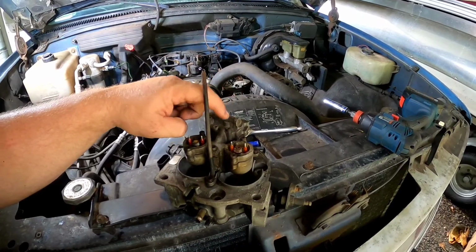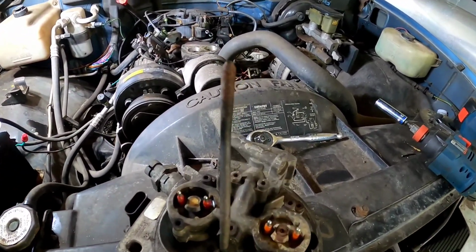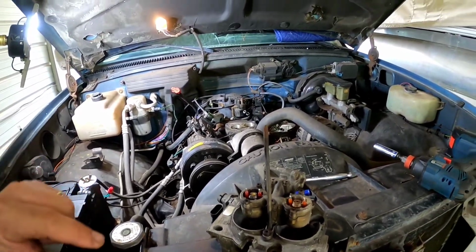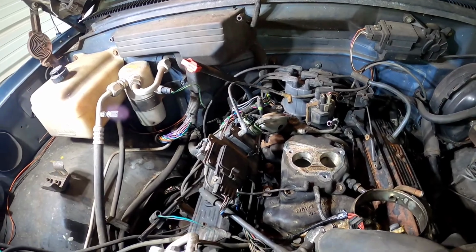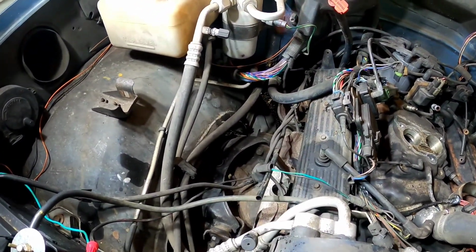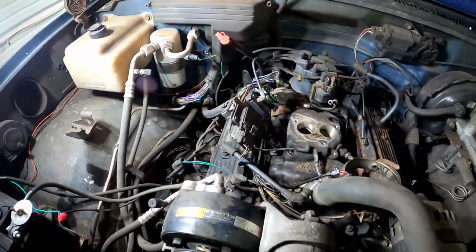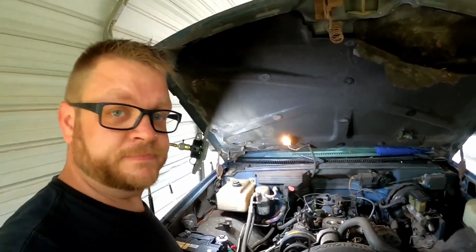We're going to get a new diaphragm kit that goes in here and have fun with all these little Torx bit screws that GM used on there. But I think we'll really be headed in the right direction once we do that. Intake manifold looks pretty good. I don't see anything crazy going on. Typical wiring looms come off of the wires, but all the wires aren't chafed. They look to be in really good shape. So we're going to rebuild this throttle body and see what happens next.